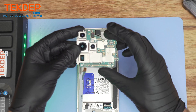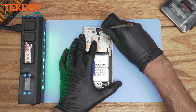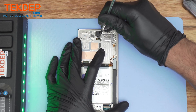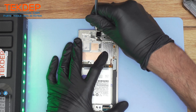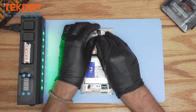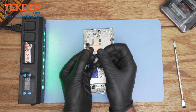We're going to go ahead and remove the main board. Use the prying tool on top and try to go easy on the octa glue — the white glue they use — to make sure that the front camera sits in the front panel. And there goes the front camera.